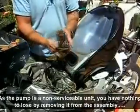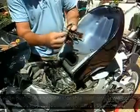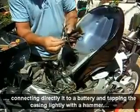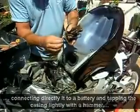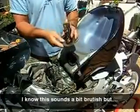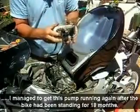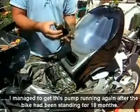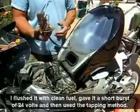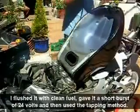You're only interested in the yellow and red wire and the earth. The others are for on-road use, for a warning light, fuel light, reserve light, that sort of thing. And that's what these sensors are. So that should have a filter on it as well, so it's probably going to be a good idea to replace it. So there you go. Done. About 5 minutes. Alright mate, get back to you soon.